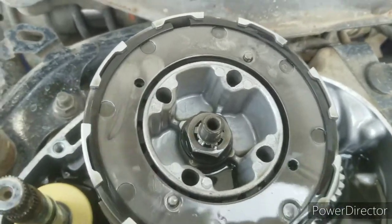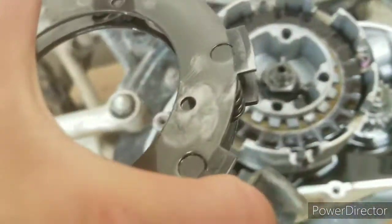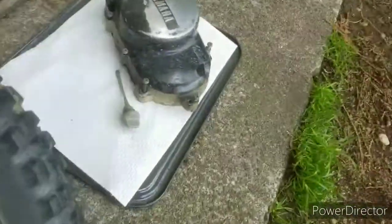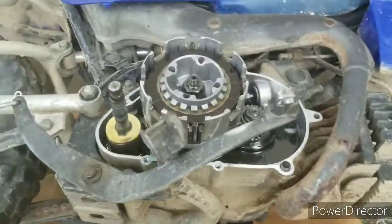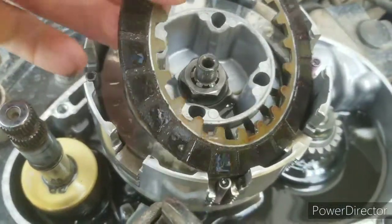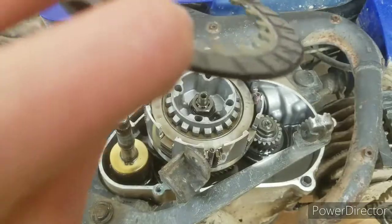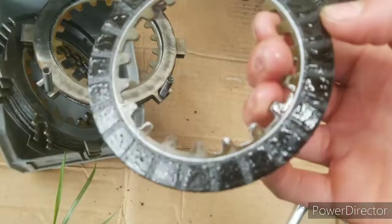It's going to be pretty difficult, so I can't film it. Once you take out that disc, you have to be very careful because there's a disc that has a bunch of springs on it — just like that. Since my clutch is still hot because I just cooked it today, just be really careful. These are your clutch plates. Pull out the clutch pack — you're just going to be replacing these discs one by one.